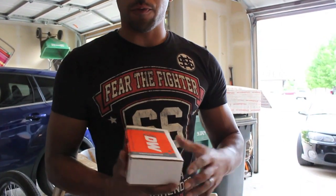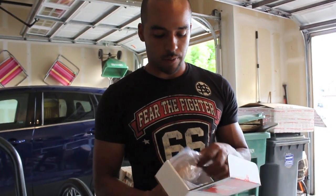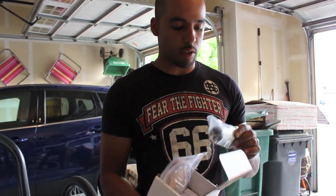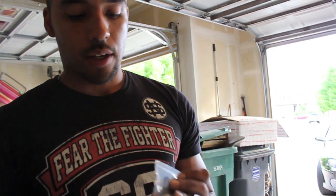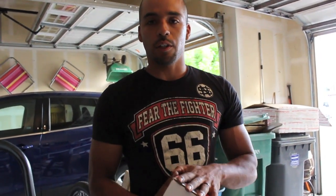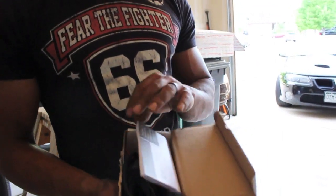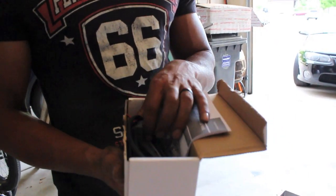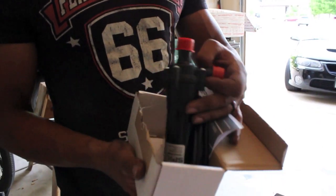I got a new fuel pump because you need a lot more fuel when you run a supercharger. With a supercharger for the GTO, you could get these little guys — it is a DW300C. It's a stock replacement for the GTO, so it should just drop right in the tank. A lot of these parts you could get from a factory ZL1 car or a CTS-V.